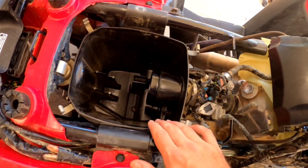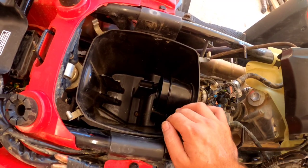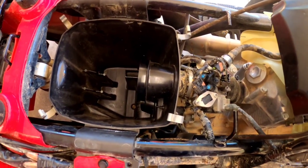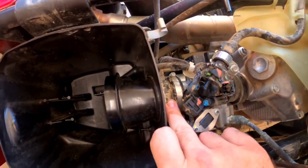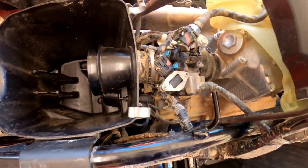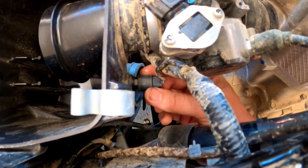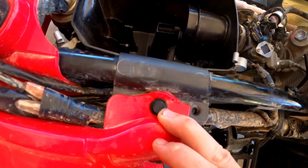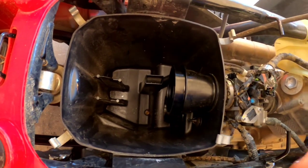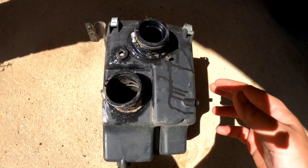Next it says to take off your air filter - I went ahead and did that because ours was due for a change. Now to take the airbox out completely: unscrew the clamp that holds the air intake going to the engine, take this hose off by pinching those two together and pulling right off, disconnect the AFM, then come over here to the two tabs on each side, pop those out, and the airbox will just slide right out. You just have to maneuver it out.